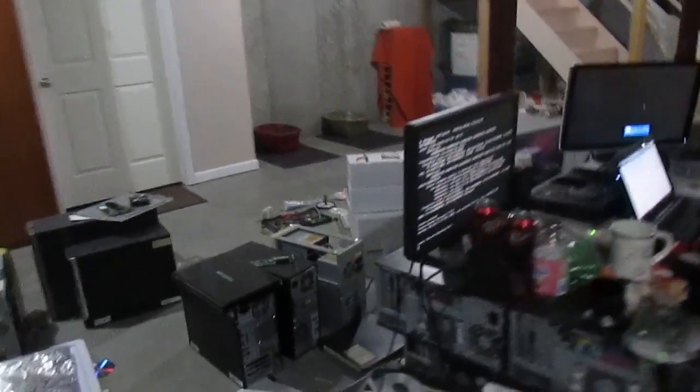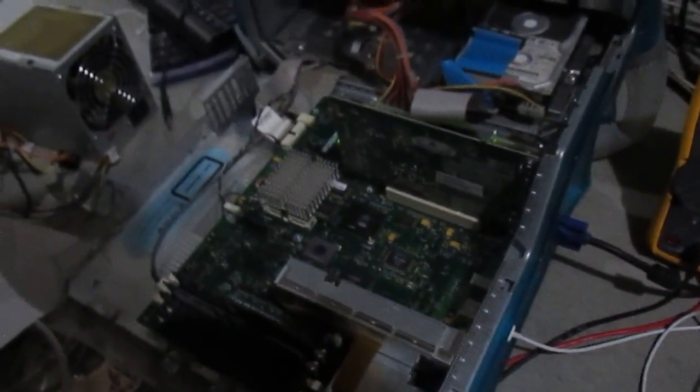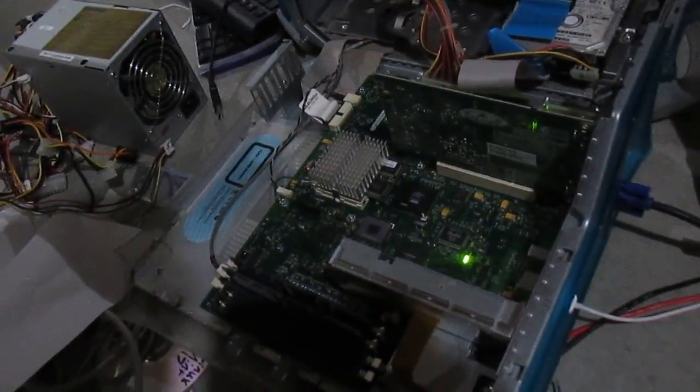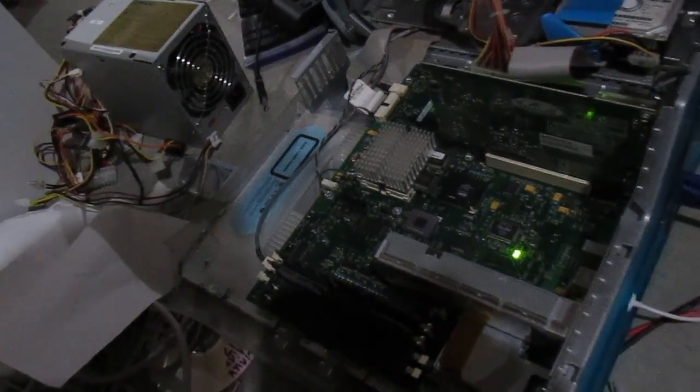To be honest, I was looking to get a file system check by booting off of the CD. So let's see if doing a file system check here will help. It said on the forum to hold down the shift key, which will force a system check through OS X when it boots up, so hopefully that'll do it. I won't be in verbose, so I can't actually verify that it's doing that, but hopefully that'll do it.